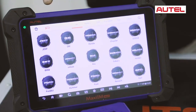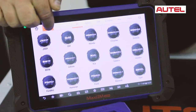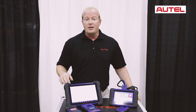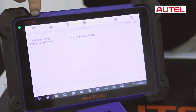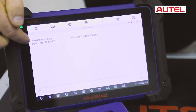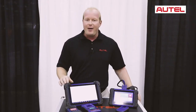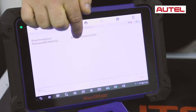In this example, we're going to use a Chevy Volt. Going into GM, we can auto-VIN the car and automatically pull up the vehicle information. You will notice on these vehicles we're able to pull the pin directly from the vehicle to relearn keys — and yes, that includes Chrysler pins. On this one, we're going to read the immobilizer password. By reading the password, the tool will store that password to be able to relearn your keys.